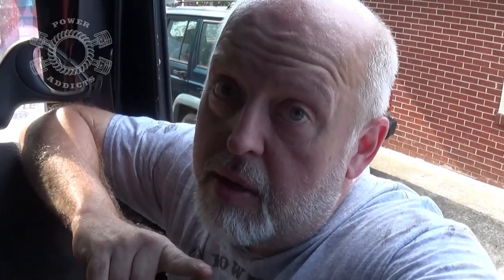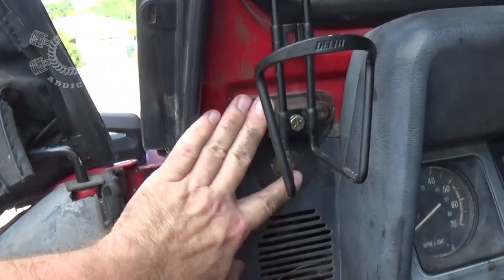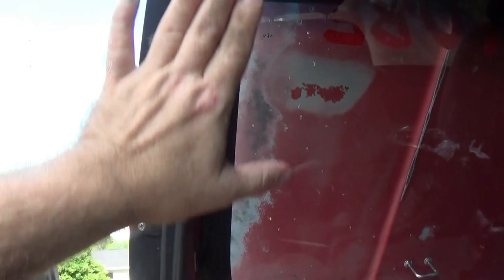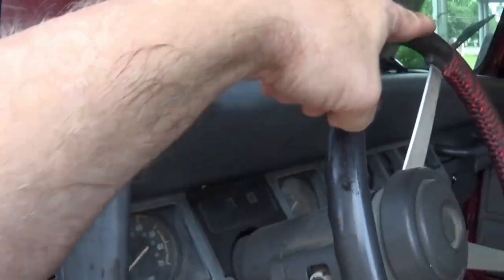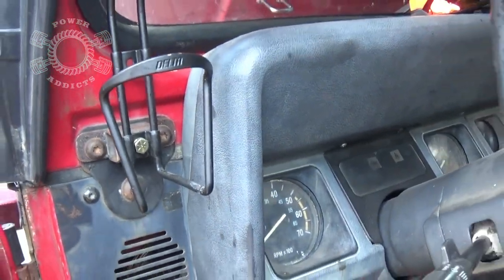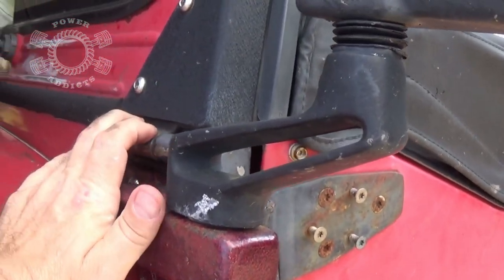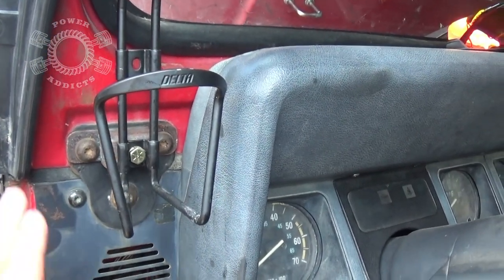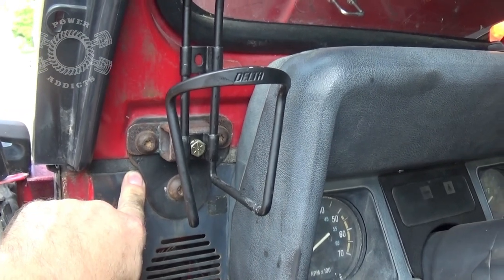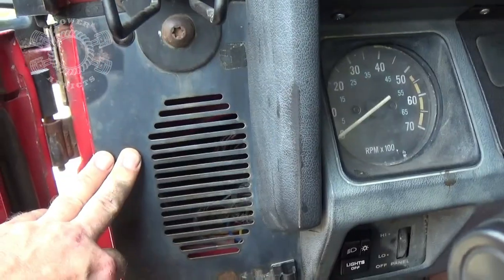Now one of the most common methods is to completely remove the dash, and here's why I'm not going to do that. Oftentimes these hinges right here are so seized up that once you get the bolts loose — and you've got your ones up here on your spreader bar — then you have to lay the windshield forward, which exposes the screws right in the top of the dash going all the way across to the passenger side. Well, oftentimes the hinge is so seized up that it doesn't want to move, and then people say 'I'm gonna make it move' — next thing you know, you've busted your windshield. Honestly the easiest method would be to lay the windshield forward and take all the little screws out, but in the everyday world where everything's rusted, it's going to be a pain and you're risking damage.